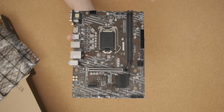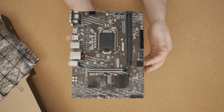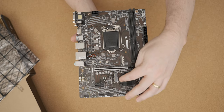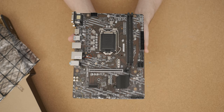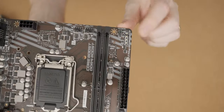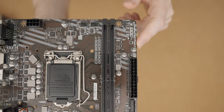One thing that is reasonably impressive about this very brown motherboard is it still has a bunch of modern features. You have front USB 3, an M.2 slot for storage, another M.2 slot which you can probably use for a Wi-Fi module, and there's even an RGB header on it, which is surprising. Up in the corner, you can see what look like post LEDs, which will help for diagnosing any potential issues with this motherboard.